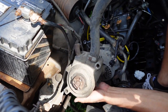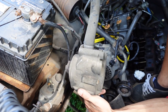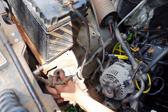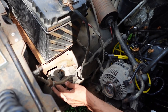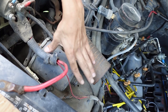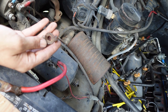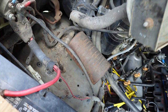Here's the smog pump. Like I said, years ago when I was little we emptied it out just so we wouldn't have to use a different belt, but we're finally going to be deleting it. Another thing to get rid of — I'm pretty sure this is the EVAP here, it's all broken up and nasty, the hose is broken off. I'm going to take off this bolt and see if it comes off. Got rid of that canister. This other canister belongs with the smog pump — I got the two bolts from underneath the fender liner, both 7/16ths, so it just pulls right up.